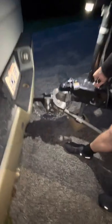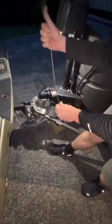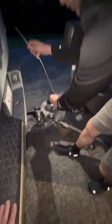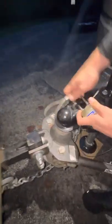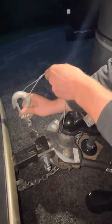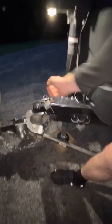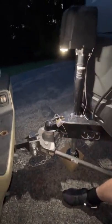And then what you're going to do now, also, before you lock this front piece — this is your trailer brake, so this is for emergencies. This will hopefully never be used, but what you want to do is put it right in here, lock it in the tongue with your trailer lock, just to keep it out of the way. And then you're going to take this chain and hook it right through the top of it, just like that, and clip it right back on. This is just in case of emergencies — say that the trailer did come unhooked. This is going to pull your trailer brakes and keep everything a little bit safer.